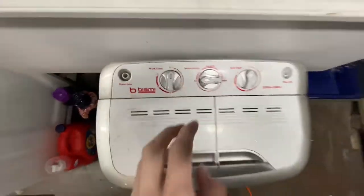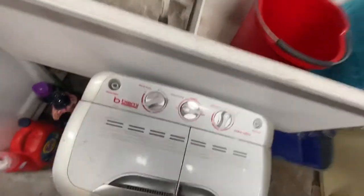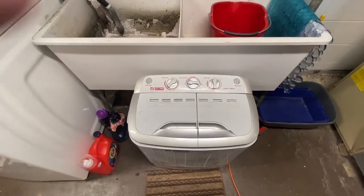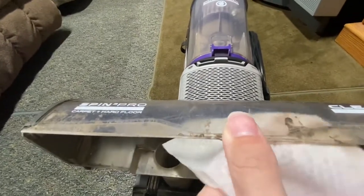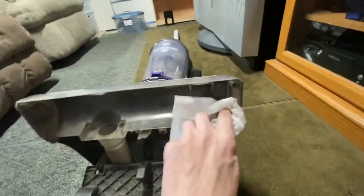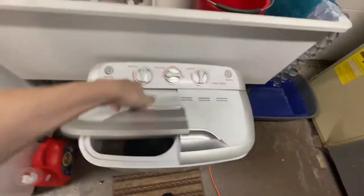What you would do is take your brush out and feed it through here. This one doesn't actually need a new belt this time — I'll eventually replace it, but I needed to get to it to clean that area. Let's do the filters. Now that the filters are done washing, let's see what we have. I'm going to run this for another three minutes because they seem kind of dirty. I run it in three-minute intervals to see what happens and make sure it doesn't get destroyed. Now I'll show you how to clean the belt area — the best way is to go around clockwise in my opinion. Go around this area, make sure you get the dust out.